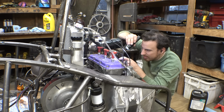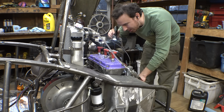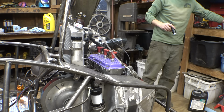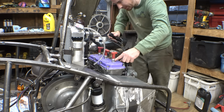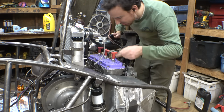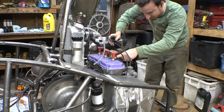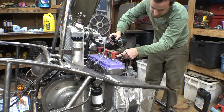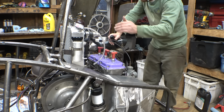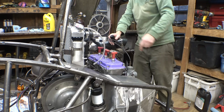You gotta be kidding me. Really? So I didn't see any leaking around this. I don't see any water on the spark plug holes, which is awesome, but I did see water leaking out of this triangle gasket right here. So let me drain the coolant again. I'll take this off and then put some Honda Bond on that.